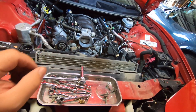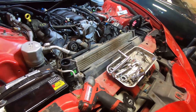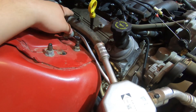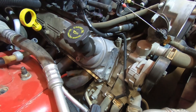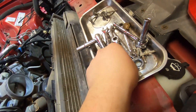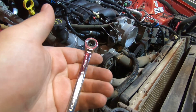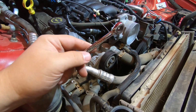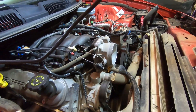So far I got the radiator plastic piece off with the intake — there are four 10-millimeter bolts that get that off. I have the radiator drained, and right now I'm working on getting the coil packs off. There are five 10-millimeter bolts on the '99-and-up cars. The back one is kind of a pain to get at, but I used a ratcheting 10-mil flat wrench and was able to get my hand in there and do the trick. Now I'm gonna go start on the other coil pack.